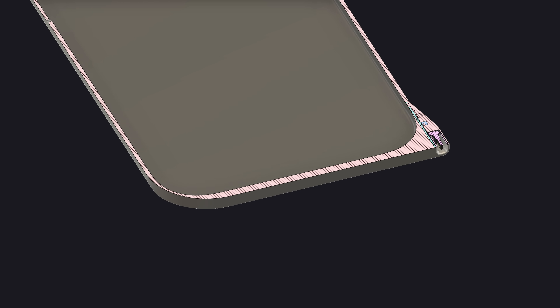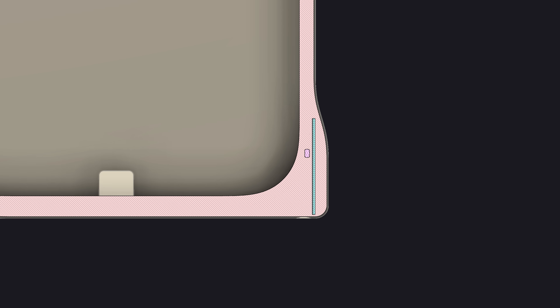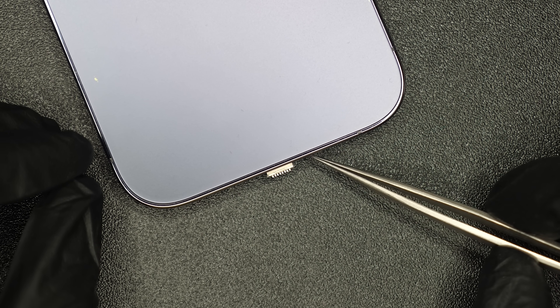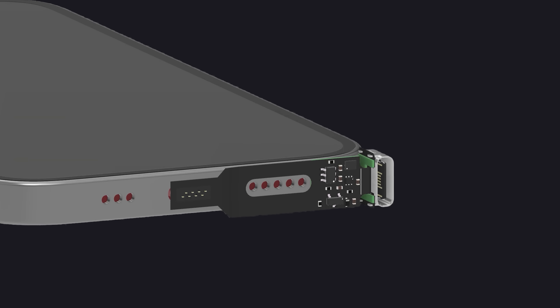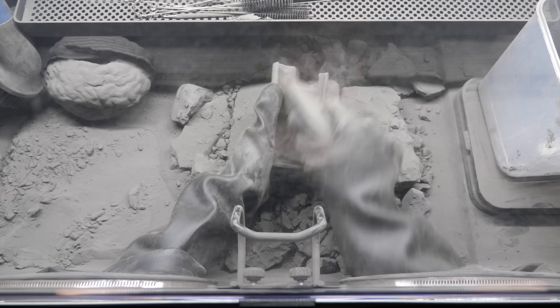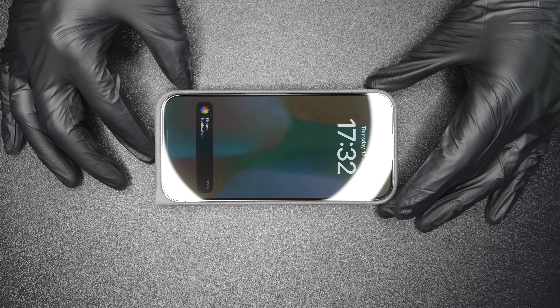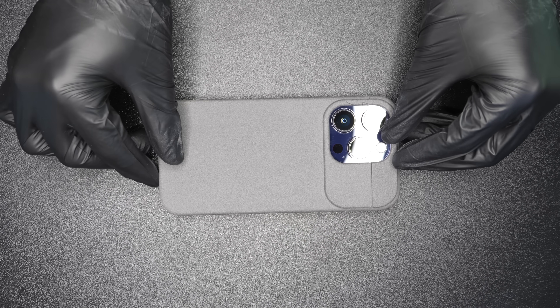I tried and tried again to remove this bump, starting over each time, making sure the electronic components could fit. But I finally understood that there needs to be a tiny chin on the bottom anyway, because that's where the lightning port plugs in. The circuit board goes around the speaker hole and then we need to fit the components here, and then it bends 90 degrees to place the USB-C port where it belongs. Ultimately, it's just an equation you need to solve — finding the smallest chin and the right wall thickness to create the volume that houses the USB-C connector. Now I just need to turn it into atoms with my Formlabs Fuse printer. And there we have it: the thinnest case I could come up with that houses a new USB-C connector.